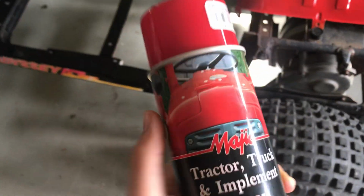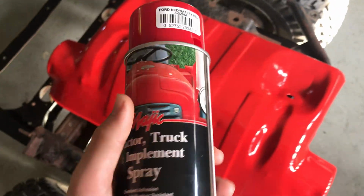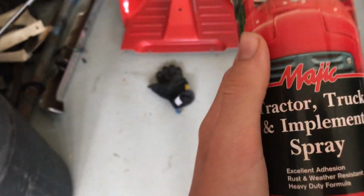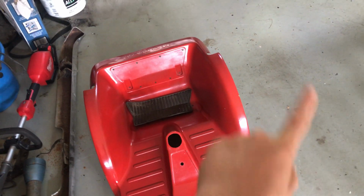With this paint, it sticks well on certain materials. There's certain fiberglass paint, but we couldn't really find the right color. They had a small selection. Most spray paint should work on metal and fiberglass the best. We only put on 1 coat, but we're going to do a second coat, so we need to pick up a second can of that, spray it over, and then put a gloss, really durable, protective clear coat over it.